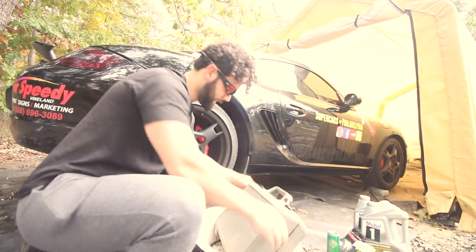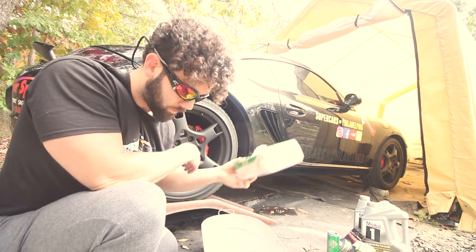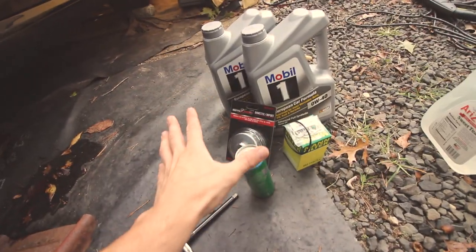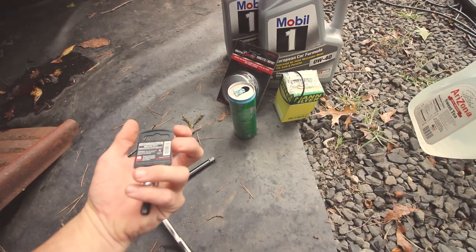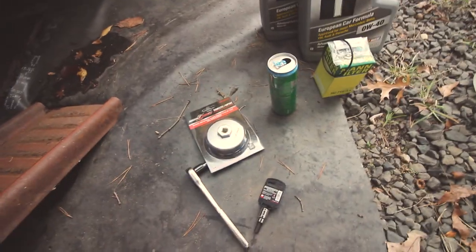Still haven't got my gloves — about to go do that — and get some oil pans too, considering this holds a good amount of oil. I've also got some extra tools just because I think I'm missing some sockets. We've got enough volume capacity in these pans. I've also got my gloves. I'll bring you under the car with me to show you all the parts and everything you need. You need a ratchet and a Torx socket — they're calling it a hex, but hex and Torx are essentially the same thing — eight millimeter, three-eighths of an inch drive.